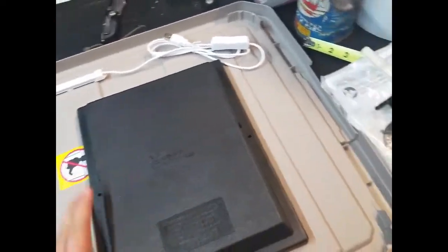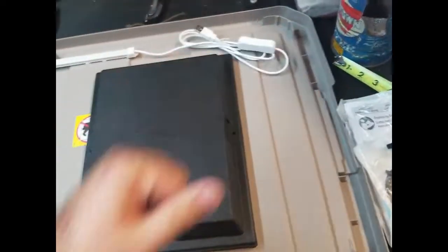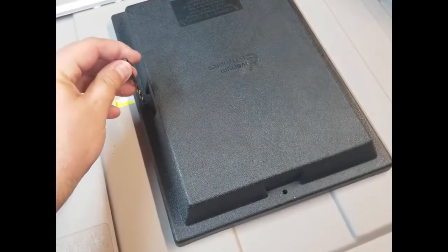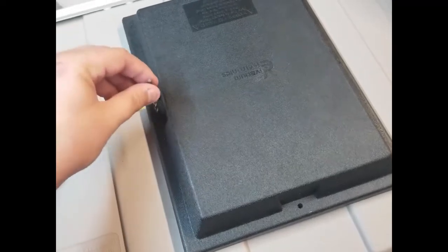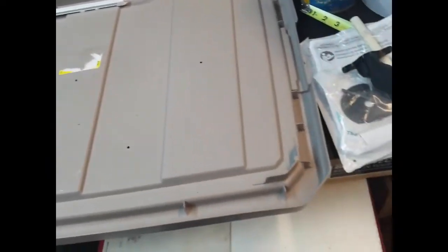I think if you're going to do one end, it needs to be the end that has the cords on the same end — that way you don't have one cord going left and one going right. For the sake of continuity, it's probably easier to keep the cords going out the same end. I laid it where I wanted it, took the drill, pre-drilled holes so I know exactly where it's going and can mount it right on through. The drill bit is a 5/32nds, matched up with the size of the screw — a 3 by 5/32nds — and I'll mount it with some nuts.